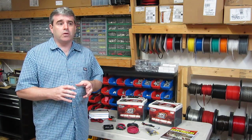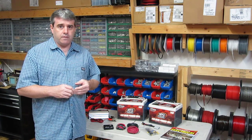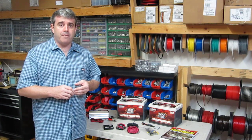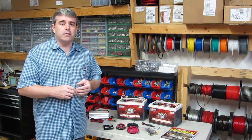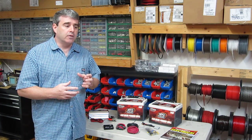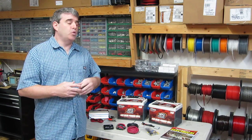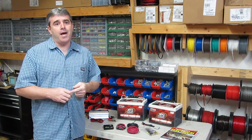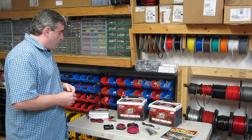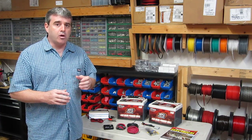Now in the case of our electronic fuel pump, that is undesirable. As the vehicle is currently, the electronic fuel pump is set to make 21 pounds of fuel pressure. If we increase the voltage and current that goes to it, we're also going to increase the amount of fuel that the pump moves. And if we're not able to get our fuel pressure in order, we would have to do so manually via the regulator. The fact remains that we're still going to move a greater volume of fuel, which can cause the heating of the fuel — an undesirable effect.